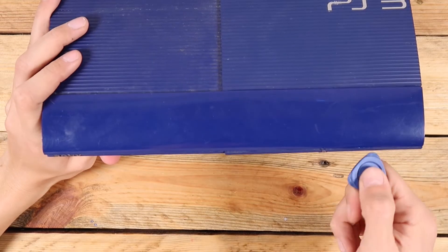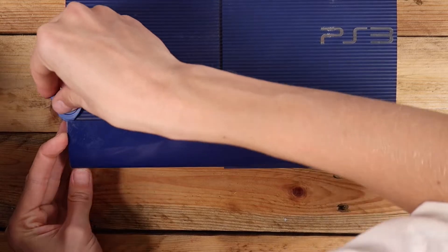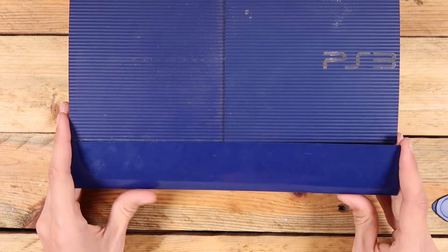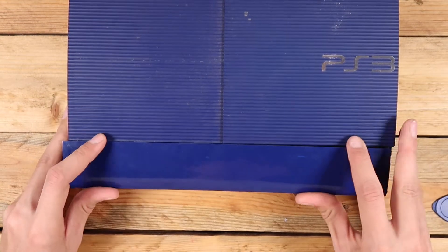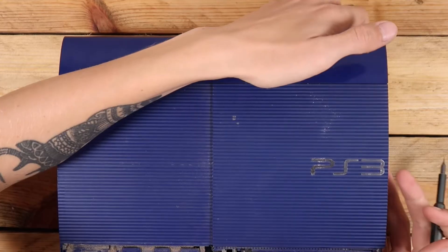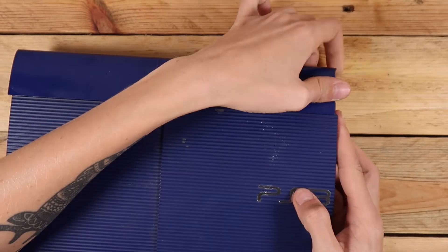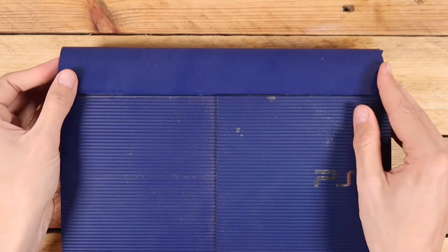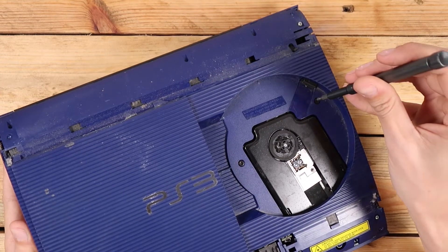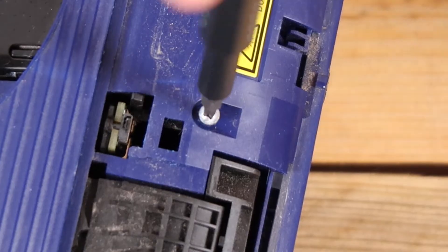Back on the top we need to take off the plastic covers. The front one is an absolute nightmare to remove — you need to pry up on the front half as well as just the left side of the back half, then lift up the right side and slide it all out to the left. The other cover is much easier to remove; you just need to push in this tab and the whole thing slides to the left. All that's left now is two Torx screws on the disc drive, four Phillips screws on the front and one Phillips screw on the top right corner.